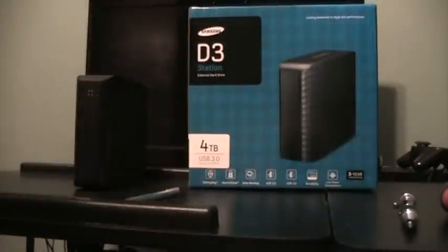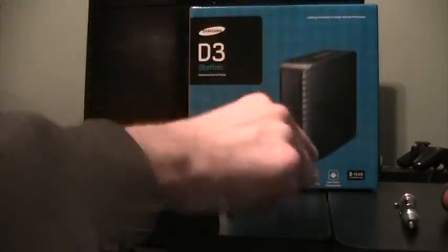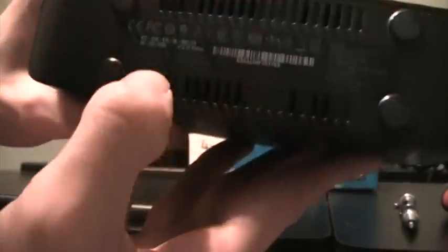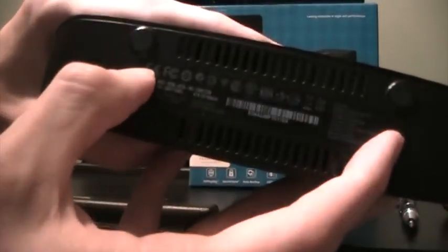Know that by doing this, most likely you're going to void the external case's warranty. So first we're going to need a letter opener because the screws are hidden underneath the bumpers. To know which ones you need, look for the labeling and look at it right side up — the two bumpers that are above it are the ones that hold the screws.